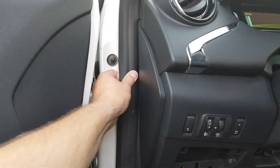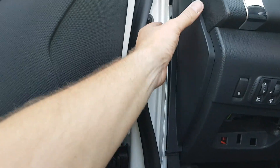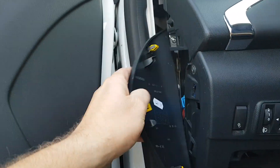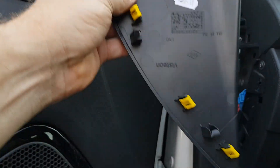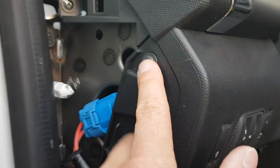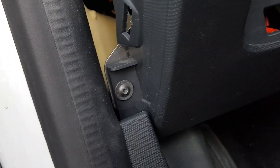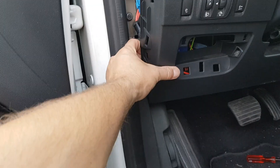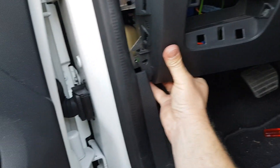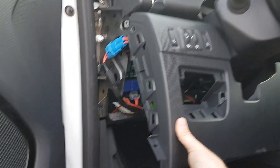Here, the rubber can simply be removed like this, and then you remove this plastic panel — you can see the yellow clips that hold it. To remove this panel, you need to open these two screws here, then pull it out so it loosens, and then you can remove the whole panel. You can see it's already shaking — it's only hard because I'm holding the camera. You can fully remove this.